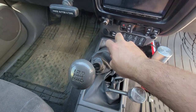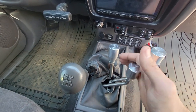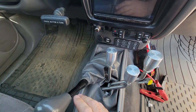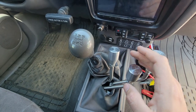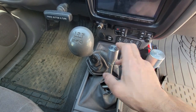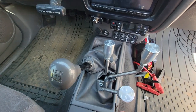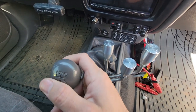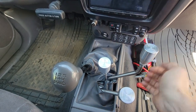While I'm off-roading, it's in low, it's in four-wheel drive, and then this is the variable. Like coming up to an obstacle, get through the obstacle, pull it out of there, and then continue on. But when I'm in low, I'm able to use second gear, which is something I never could do. And I'm also in third gear. It's just slightly lower than being in just low range by itself. I don't use that very often, but we were just in mud the other day. I put it in low second gear and just let her eat, and it just ripped through a mud hole. So I was pretty impressed. In general, that's the rule of thumb.